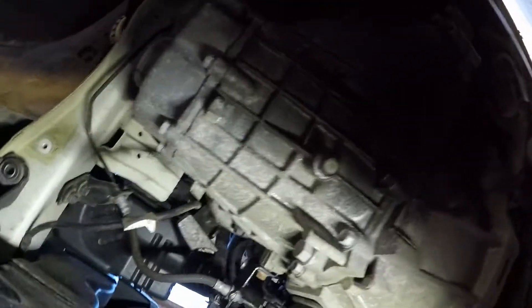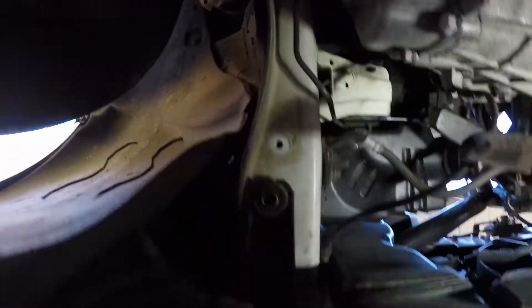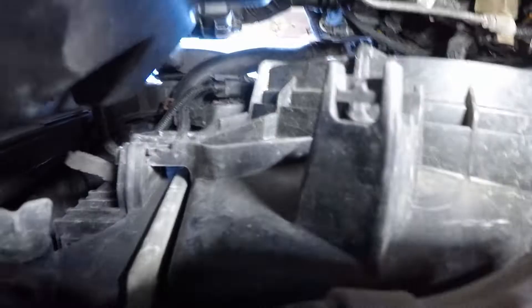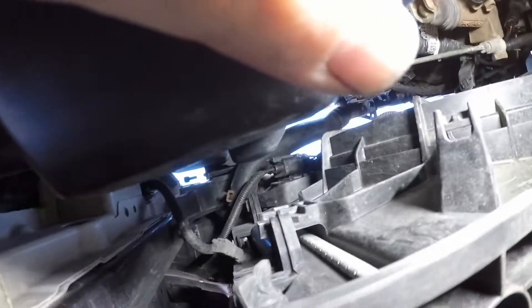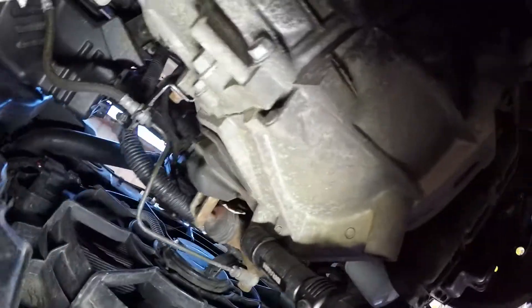When you get the bottom off, you're gonna have this little breather box with a 10 millimeter bolt right next to it — that way you can move it aside. Your petcock is right there, and you want to get a pair of pliers in there. Mine was tight. You loosen and take that bolt out, then you can loosen it up to get your hands in there. See how much easier it is when you take this whole skirt off — you can also inspect the car too if you're doing other things.